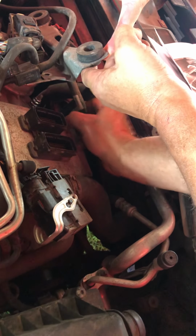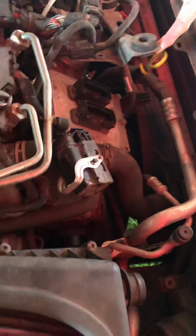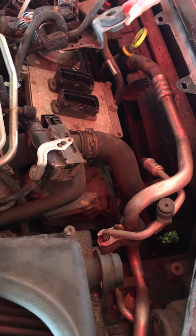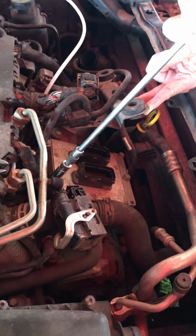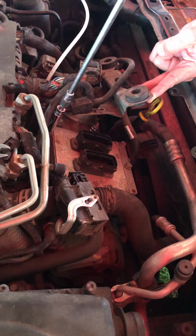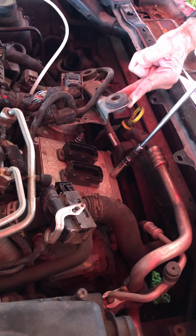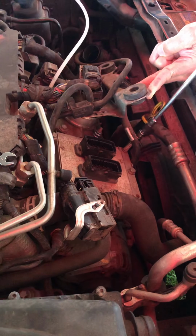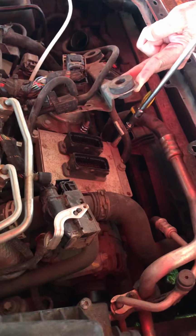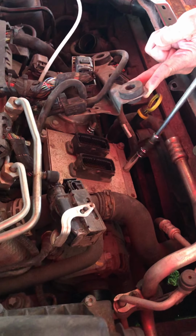Like I said, the key is to start all 3 bolts before. There is a slight misalignment. We'll take that into account. Now we're going to torque these back down. Now these will pull into the rubber somewhat, so you'll feel a little resistance start. Excuse me, wrong one. Just take your time and move around it. See it slowly pulling down, and you'll feel it draw flush. And again, 16 foot-pounds.